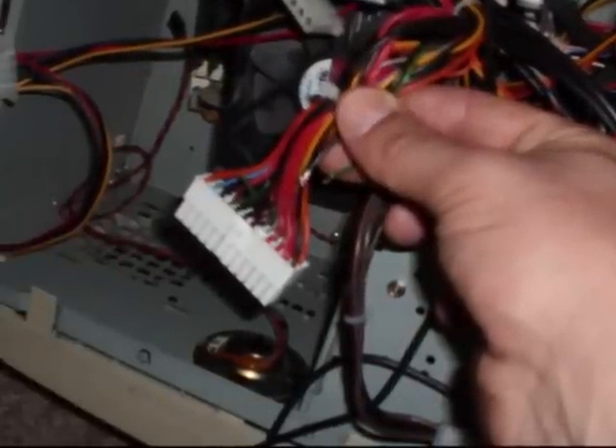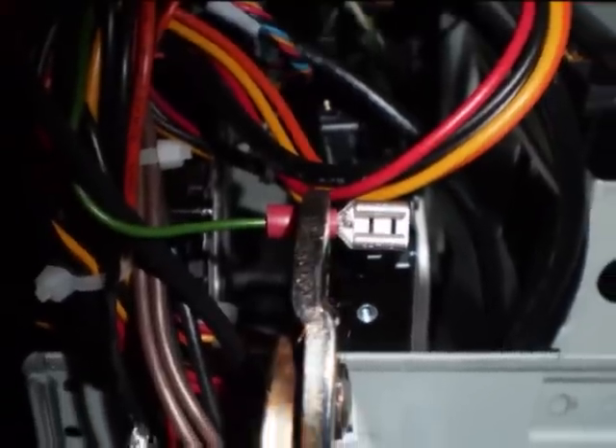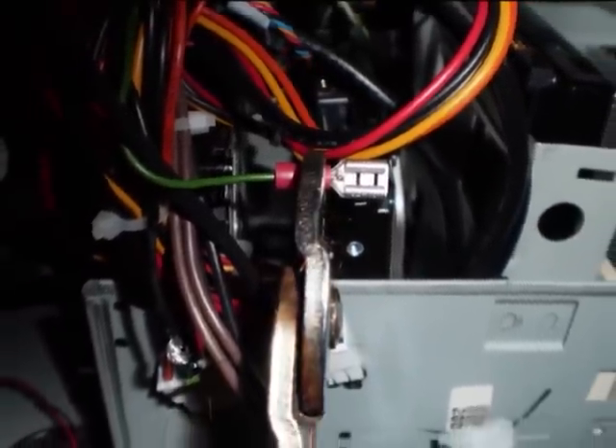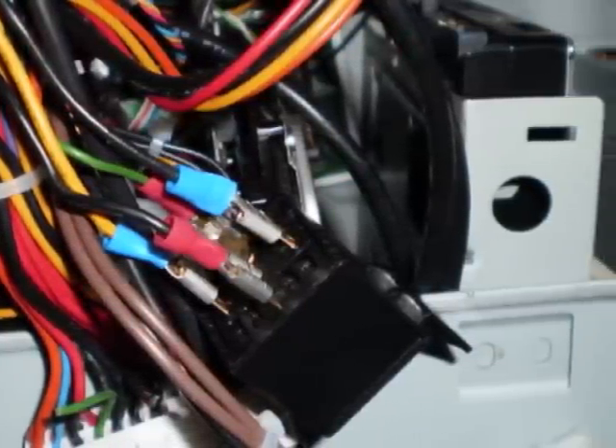In this picture, I've cut the green and black wire. Now I'm splicing on the wire end. All that is left is hooking these two blade connectors to the relay and plugging the Molex connector in. Voila! It's all hooked up correctly, and when I turn the computer on, all my external drives will power up.